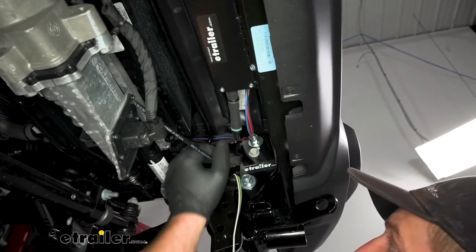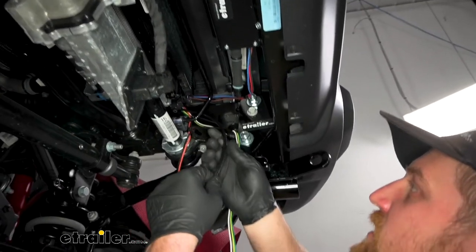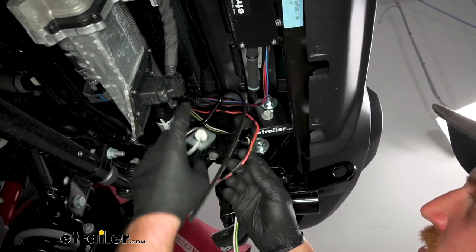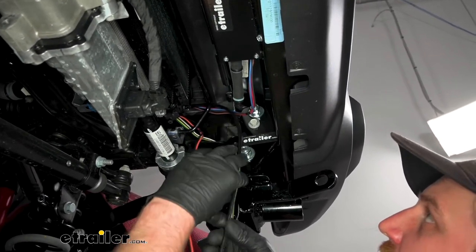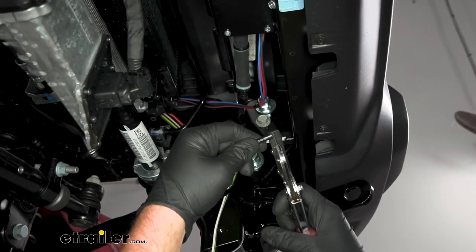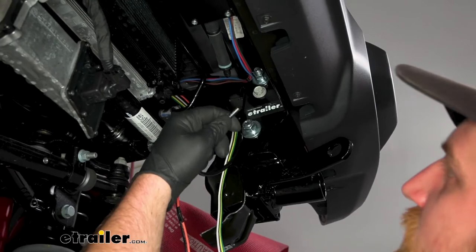You can take your nylon air tube and route it down from the top of the engine compartment down to the operating unit area. Tape the wires from the operating unit and the breakaway switch wires to the tube, then pull the nylon tube up to feed all the wires up into the engine compartment — makes it a little bit easier. Once those are all pulled up, you can hook up the nylon air tube. Make sure the end has a good clean straight cut using a tubing cutter or a razor edge — avoid regular snips, which can pinch and potentially create a leak.